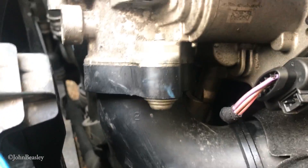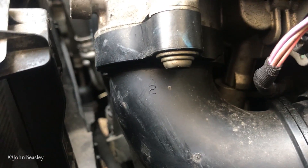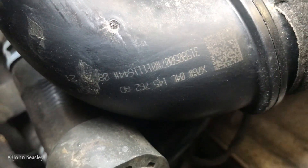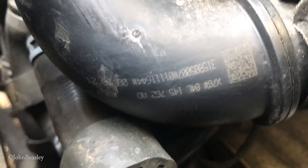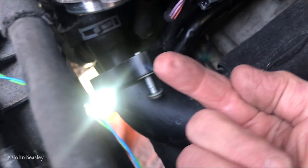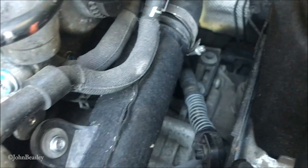So it would seem that there's either a gasket in there or the collar has split or broken during the impact of this vehicle crashing. I'll have a look and see if we can get the part number. Removing the intercooler pipe — there are some T30 screws which you have to get to from underneath, at least one of them, and then just a normal jubilee clip at the back there.